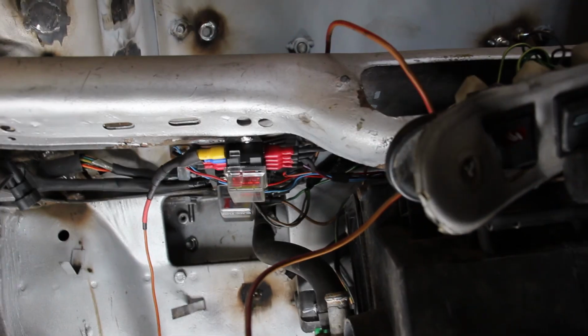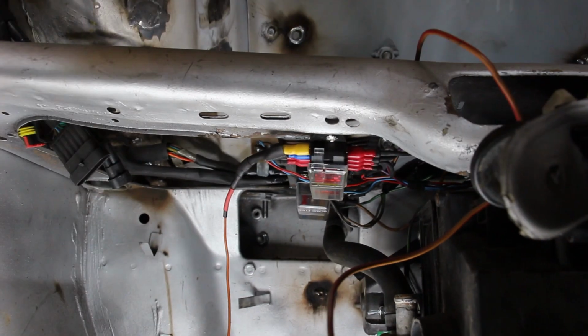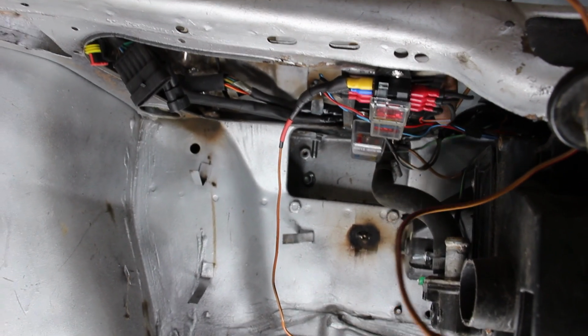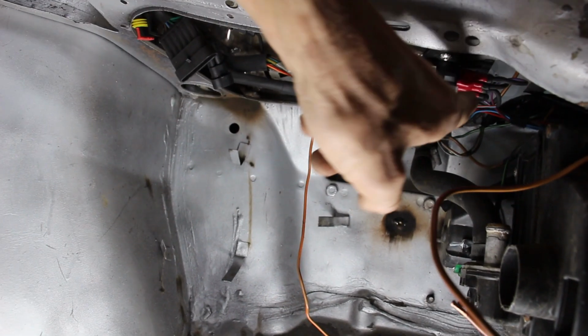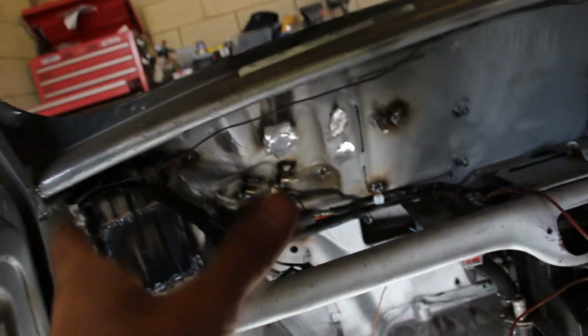Alright, hopefully you can just see under there. It's not finished. Sort of more finished than probably it was left from the factory, but not finished for me. We've got the wires that loop around here, they'll all be taped. So we have the all feeds that go in, the two that loop round the back, and these two which supply a main permanent live via fuses. So all we're going to do now is plug in all the looms for the Mini, and use touch switch on the battery, and see if it all works.